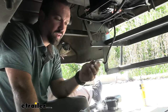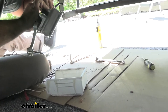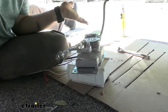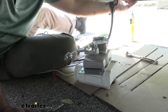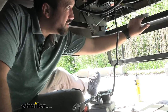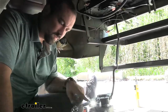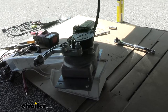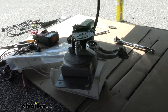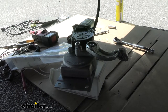With our new control module in place, I'm going to take our plug and plug it into the motor. I'm going to open up the door to actuate the arm. When your door is open, that's when your steps will come down, and when you close the door it'll pull these steps back up. You want to note which position it's in when the door is open, so you can install this in the extended position — that's going to be a lot easier than trying to do it in the closed position. With the door closed, that's our retract position. As I open the door, that should be the fully extended position, and we're going to keep it in that position while installing so our steps are not trying to fall as we put the pin in.